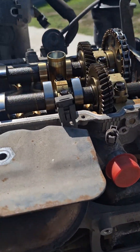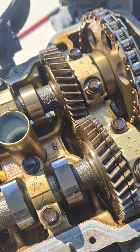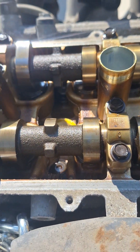The compressor is building air pressure. By the time I remove the spark plug in each cylinder, I also remove the valve cover to check the condition underneath — check for sludge and any visible damage.